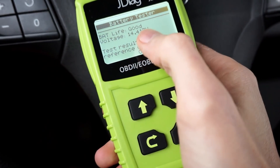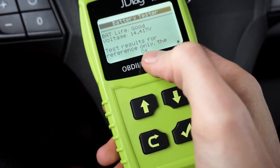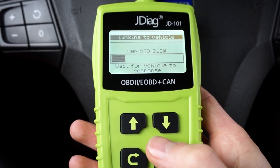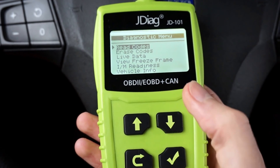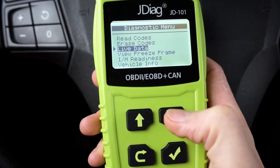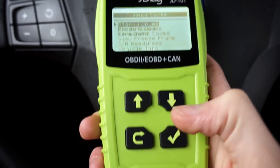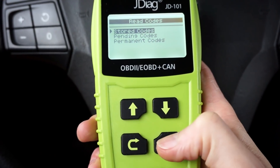The battery tester shows the voltage and indicates the battery life is good, though those tests are for reference only. Now we're going to the diagnostic section, which is the most important part. As you can see it supports a number of transmission protocols and detects automatically which one your car is using. From here we can check the codes, clear them, check some live data, check the freeze frame from the moment the code appeared, check the readiness monitors, and some vehicle information. Let's try reading the codes to find the one I produced with the disconnected sensor — so let's look at stored codes.